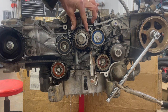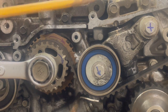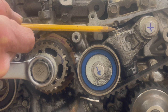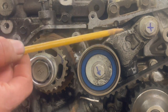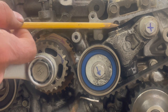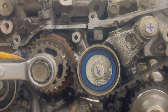So this is where you want that guard over here to hold it engaged. Watch this — note you see this little hole right here. This belt is in pretty good condition; it's not stretched, and it's right up near the top. But watch the tensioner rise up, and then you'll see the belt teeth start to climb, and then it skips.